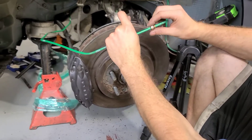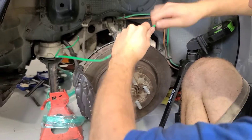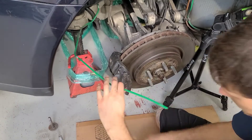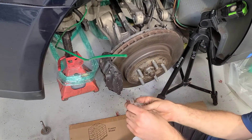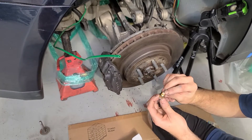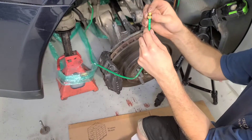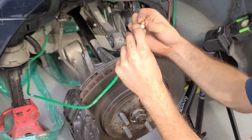Then this part, just twist and pull this off. Now we're going to take the line and wipe it off with the supplied Voss collar set. You'll notice there's a piece of plastic holding the little brass fitting in the correct position. There's a flat side — that's how this is going to go in. This right here is going to go like this, and then the flat side will stay in that same orientation with the curved side on top.